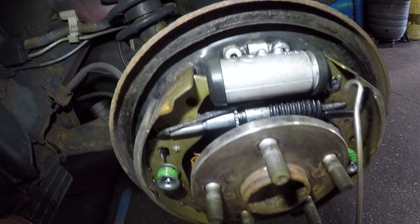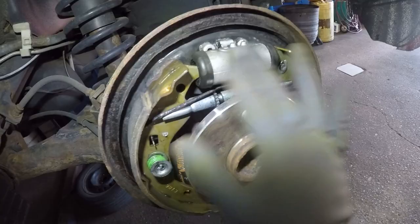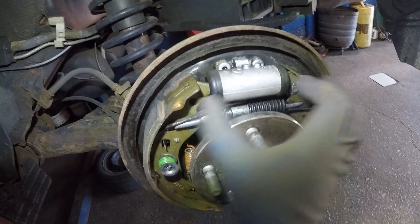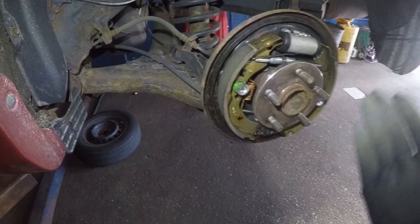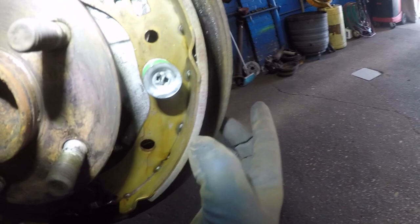No fluid, so let's put this back together. Also, you want to push on this — you see how the drum moves back and forth? Sometimes a piston inside will get jammed up and then this thing will not work like it's supposed to. Next, you want to look at the thickness of these brake shoes. They're very thick — there's lettering here. If you cannot see the lettering, you need new shoes. I can see it clearly, so this is thick enough. We're not going to change this.